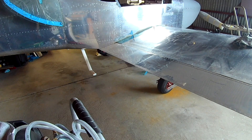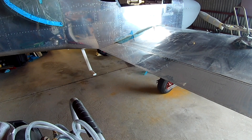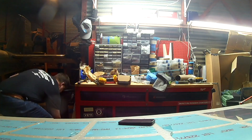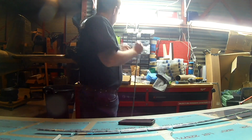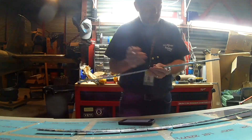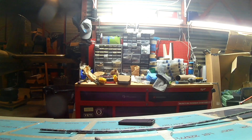Then it's just a matter of making sure the markings are where you had them. You have to go into the Garmin system and sort of calibrate the flap sensor so that you can tell it where the flap positions are — 32 degrees, 15, 0, and minus 4. I think those are the settings I have. There's a lot to do with all this wing stuff.